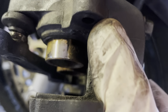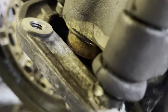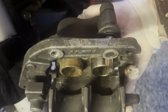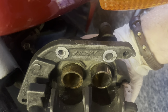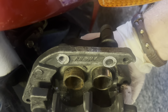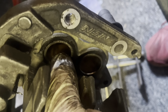Just a few minutes with a bit of emery paper and that's how clean it comes up. You should be able to grab this with grips and rotate it. I'm going to get the whole thing both sides up to this nice shiny surface, as the corrosion prevents the piston from going all the way back inside the caliper. Here you can see the difference between the one on the left which has not yet been cleaned at all, and the one on the right which has been attacked with some emery cloth and then a little steel brush on the end of a rotary tool. One important thing: there's a rubber seal in the caliper itself between the caliper and the piston. It's very important that you don't touch that seal with the emery cloth or steel brush, because you don't want to damage the integrity of that seal — that's what's keeping the brake fluid inside the caliper. Now that they're all cleaned up they slide very nicely and I'm able to push them back in just by hand.